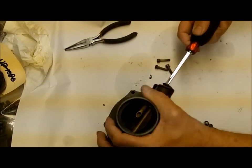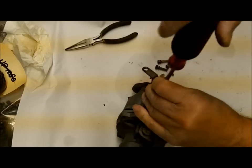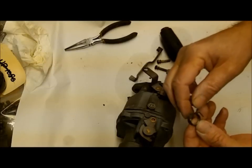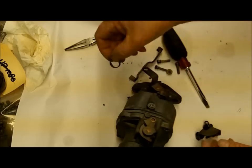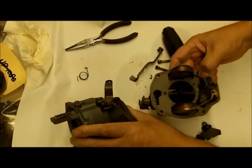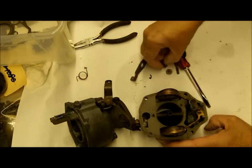As you can see, this one just has four screws on the top. This is our fast idle lever - it has a spring on it. We have a hardware kit that includes a spring. I can see this spring is no good - somebody's cut it and bent it. Everything goes in my bin here so it can be cleaned.